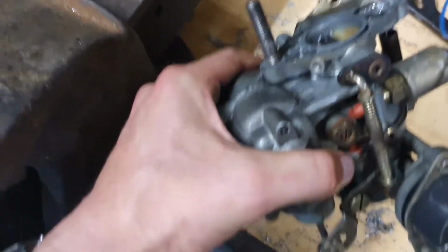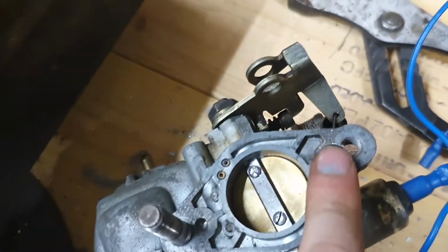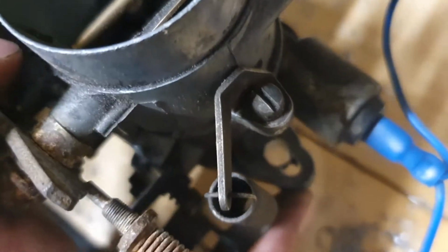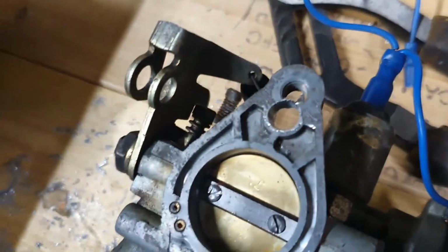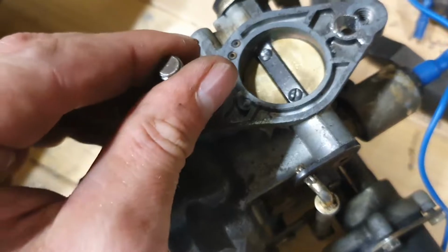So there's only so long you can watch someone actually drilling a bit of metal before it gets very, very boring. So what I've done there is I've now drilled that hole fully out. As you can see on the other side there, it's okay. Granted, it does run into the original hole ever so slightly, but because it's an oversized one just designed to take a stud through it and it doesn't have any threads in it, really doesn't matter. Just looks a little bit nasty right now.